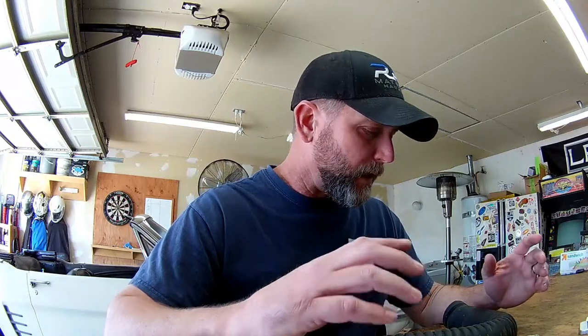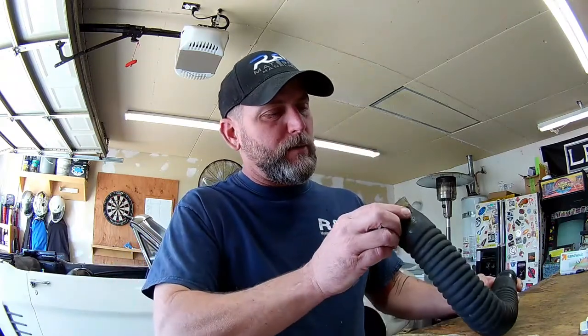And this is one of the reasons why I've decided to pull the motor out and just go through it top to bottom, clean it out really well, and then put it back together. And we'll probably have to do a quick hone on the cylinders and replace the rings and bearings and so on. But this is what I found.